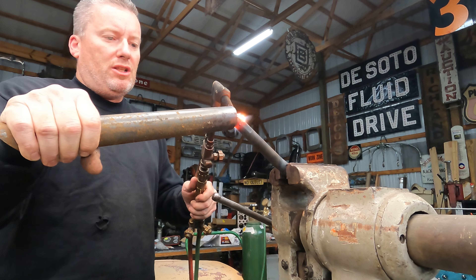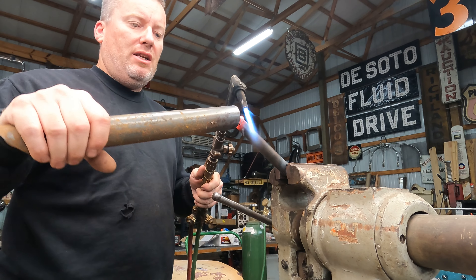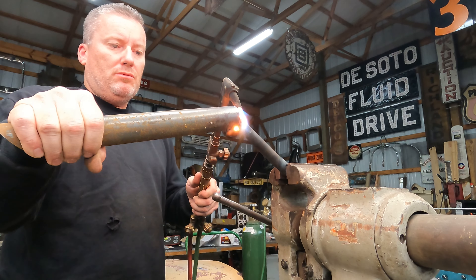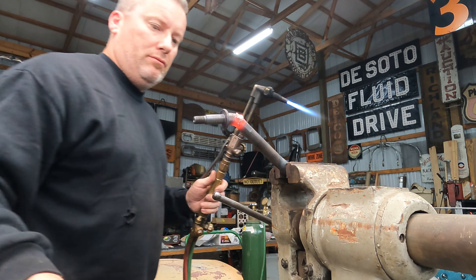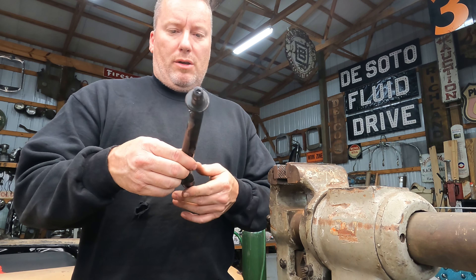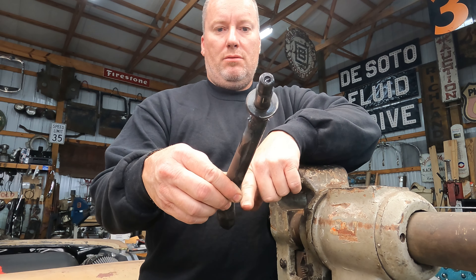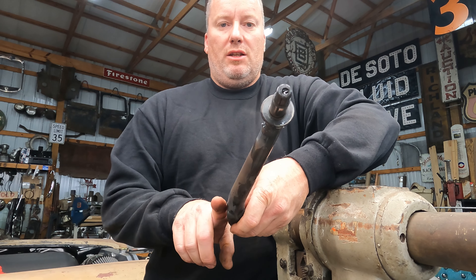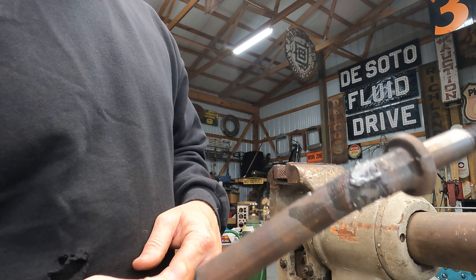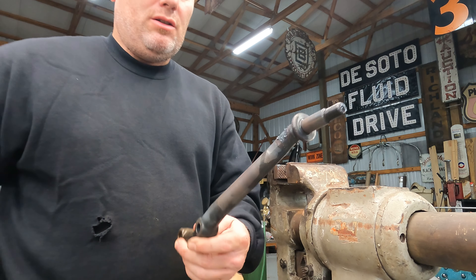Usually when you're just looking to make a small adjustment, just move it ever so slightly, just putting a little pressure on it and let it move as it gets heated up. Not getting crazy. There we go - that looks good. That looks better. Now you can see that the angle of the shock eye is now lined up here with this mounting, just going down the frame rail. Boogered it up a little bit right in there - no big deal. Once the flap disc hits that and has a date with it, it'll be all slicked up and look like a factory-made one.